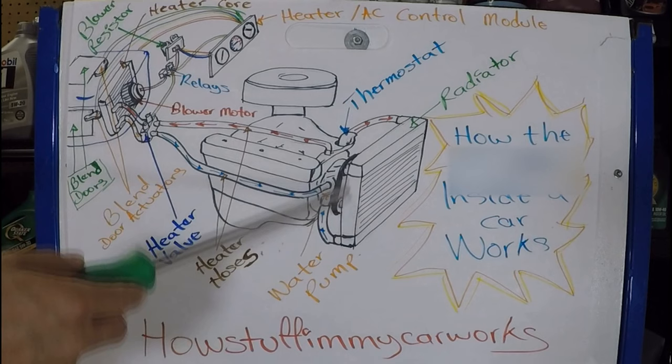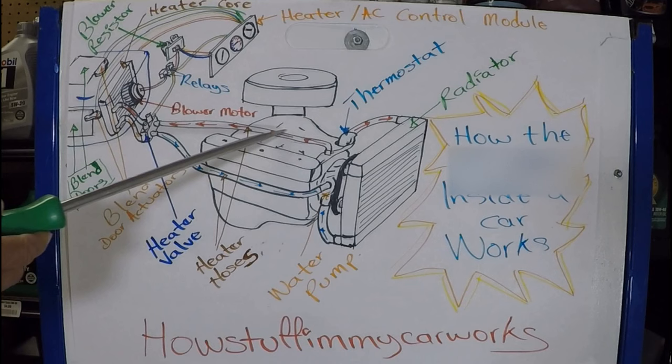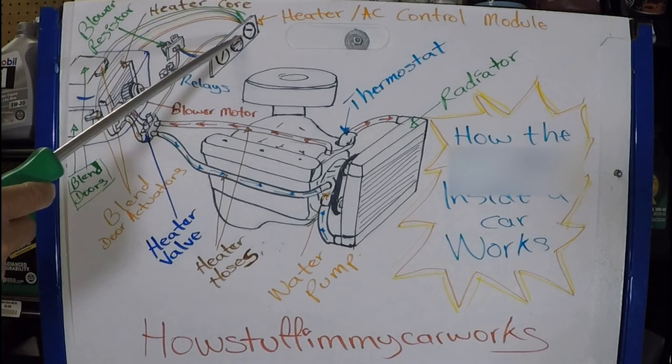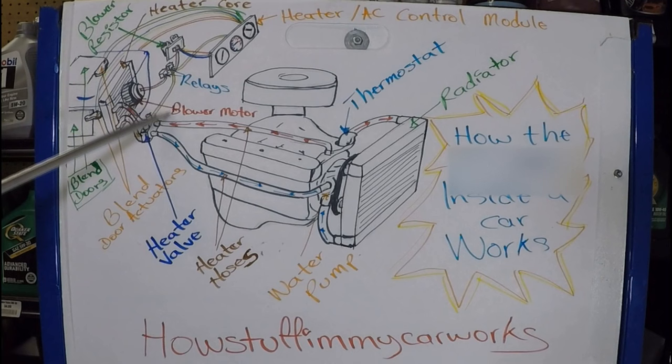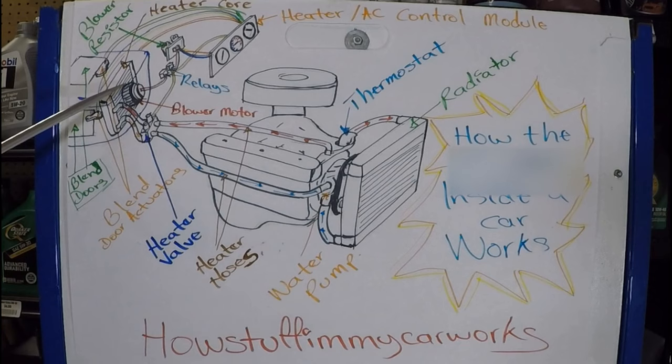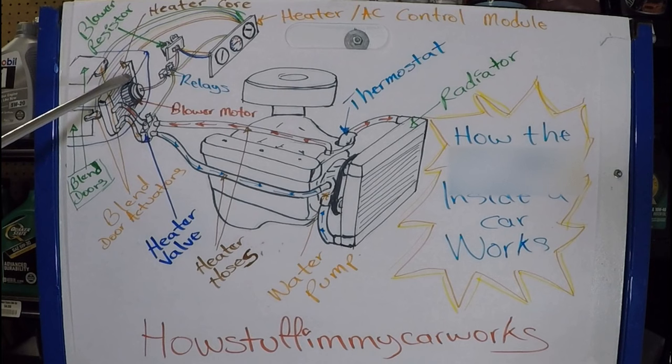So now that we know that the coolant flows to the radiator, let's move on to the heater, which is what this video is about. Warm coolant flows and it reaches a heater valve. There are two types of heater valves: one is mechanical, one is electronic. They're both going to be controlled by your heater control module. When you switch the temperature, it's going to send a signal, pass through the relay, and enable the coolant to flow so it reaches the heater core. If you look at the heater core, it almost looks like a radiator — it is just a smaller version. As the coolant enters, it has the same principle as the AC, meaning that a colder object is going to attract heat. Your car is colder, so the heat contained in the heater core is going to enter the car.